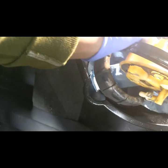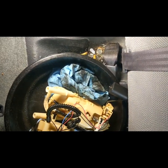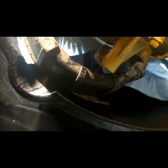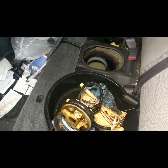I'm not mistaken — I'm going to look more into this. I need to see if those disconnected lines are the ones that suck the gas or the return line, because they were not hooked up. Everything inside looks clean. I hear pressure even though there's no power — I've got some built-up pressure. Let me check that out and see if we really need a fuel pump or if this one is just defective and we can fix it.